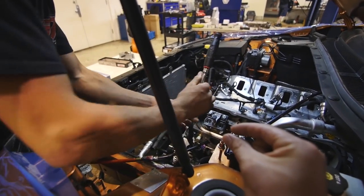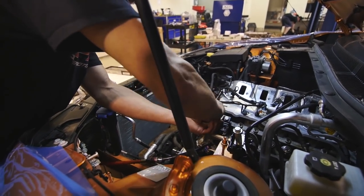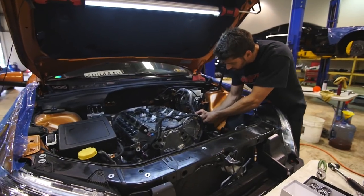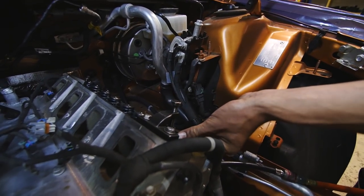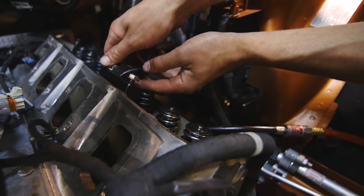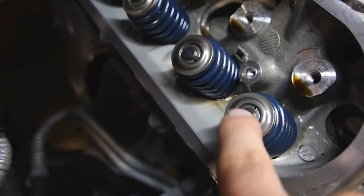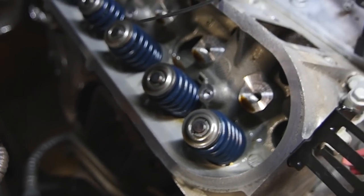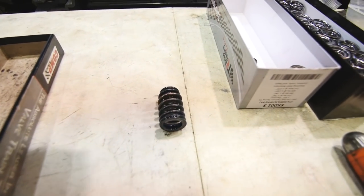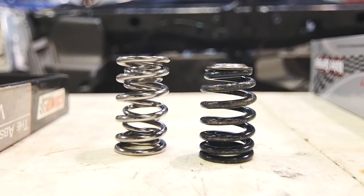You can't put the keepers on the top of the valves without air — air helps that. So those are your new keepers. Hardened. That obviously keeps the whole pack together. The keepers are holding the valve together — it applies pressure. We'll give you a little comparison here for the stock valve springs, which are a single valve spring, to the dual valve spring of the Ridetech racing valve springs.